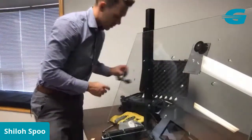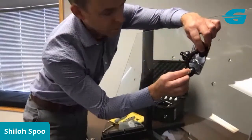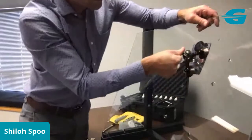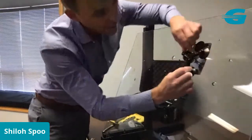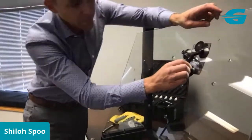So let me grab my bridge. Now, we've got our tripod bridge here. Notice we're going to set the tripod bridge right up over the repair, and we're just going to press each suction cup down. 1, 2, 3. You don't want to do this with your hand, because otherwise you can end up with one suction cup that doesn't fully adhere. So we're centered on the repair. I've got a little bit of lube so I can move the stand if I need to.